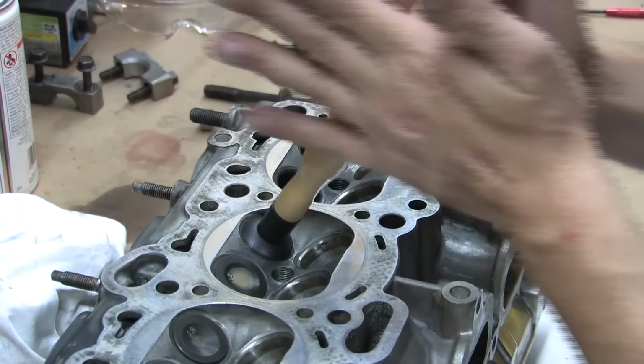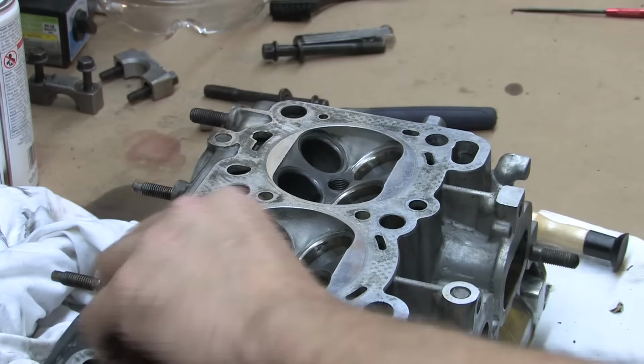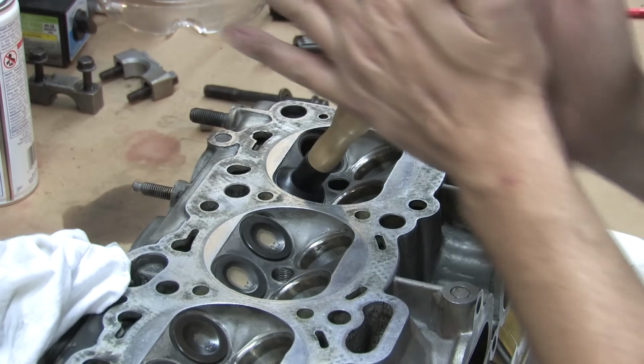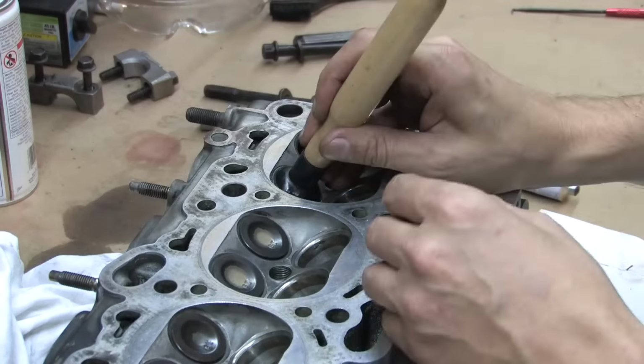You can't hear the valve seat over the noise of an electric drill. You don't get the before and after feel of the seat with a power drill between you and the parts, so it's harder to tell when you're done. All of these things are bad. It saves time, and I'm sure it can be mastered, but using the right tool and doing this the hard way will produce a better seat every time.